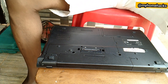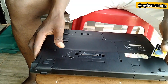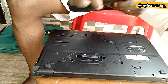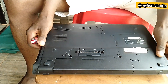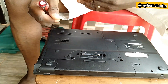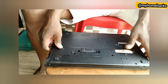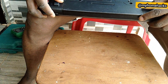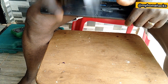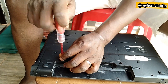We need to remove the old one from the system and replace it with the new one. To start, we want to remove the back cover of the system to expose the motherboard and the CMOS battery. But first we need to remove the laptop battery — the first thing is to remove the power, then remove the laptop battery. Now we begin to unscrew the back cover.